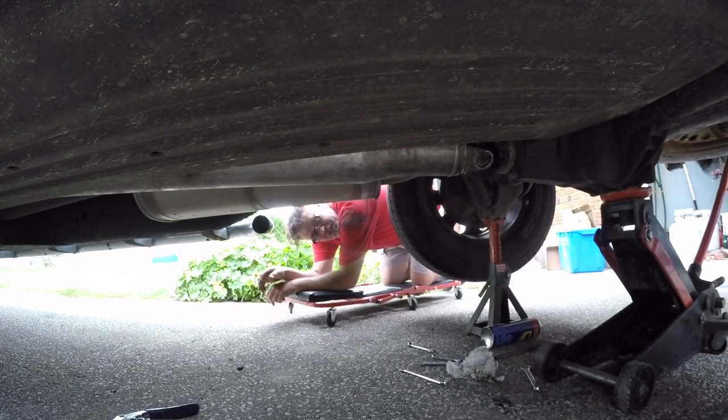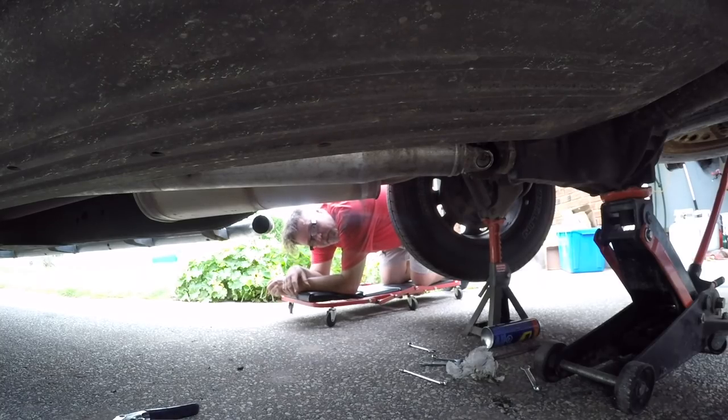So as you can tell, it's still there, very loudly. So my next thing is buy another drive shaft and try it. That's all we can do, boys. Two new universals in this truck, new oil, springs checked in the posi, transmission's fine. The camera doesn't give it any justice, but the click is coming from the whole drive shaft, not just the rear end, okay?